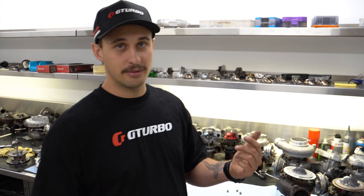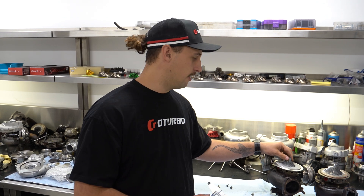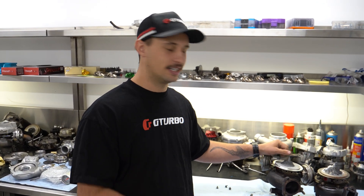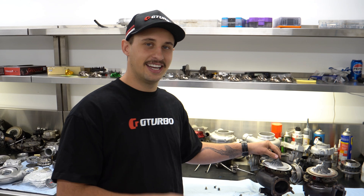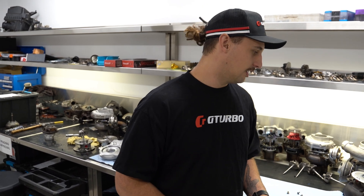The titanium lost 0.03 of a millimetre and the alloy has lost about four millimetres off the compressor - that's absolutely nuts. Jokes aside, it's not really a comprehensive test between the two turbos, but it just gives you a good indication between titanium and cast aluminium. Hope you guys enjoyed the video - stay tuned.